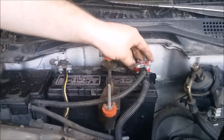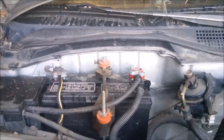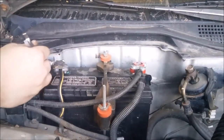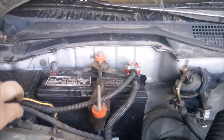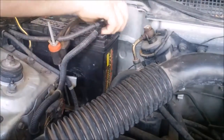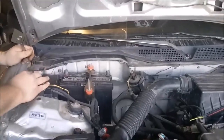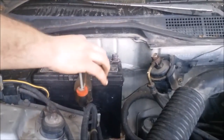Now take the battery off. Make sure you do the negative terminal first so it doesn't cross and electrocute you. Different terminals have different size nuts — mine are halves. You just have to loosen them up so they can come off. Make sure you undo the negative before you touch the positive. Keep the negative cable away from the battery so it doesn't make contact. If you need to take the battery out, mine have wing nuts — you just unscrew them and it will come out.